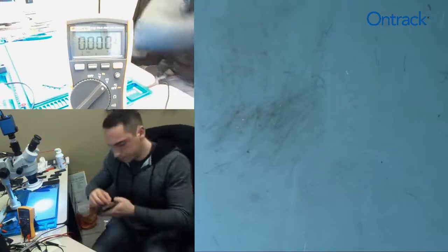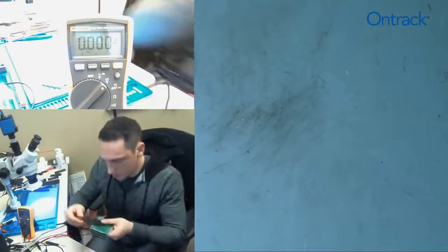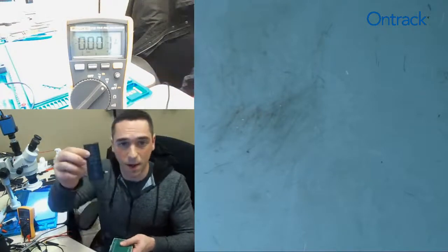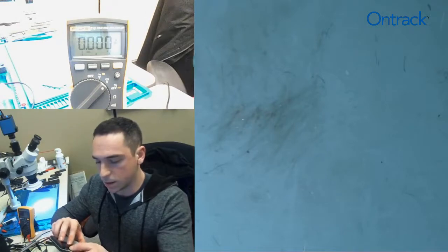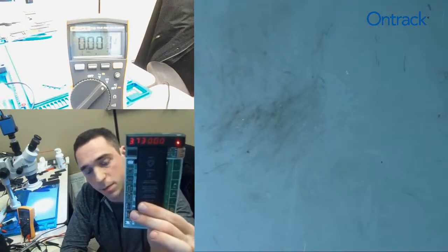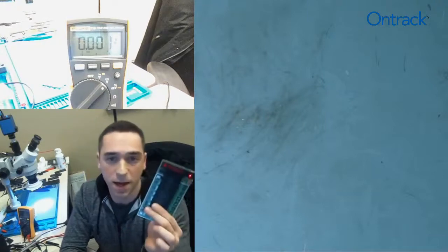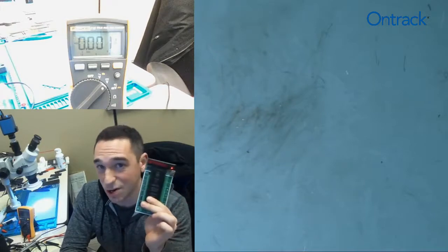Next up, we have another iPhone 6 battery. We're going to plug that into our iPhone 6 port, and here we have 3.73 volts. Now the iPhone 6 battery is rated for about 3.8 volts, so we can right off the bat determine that this battery is discharged.